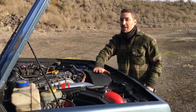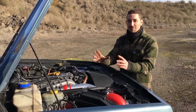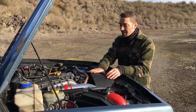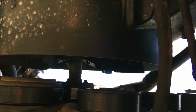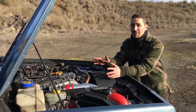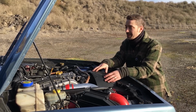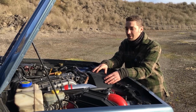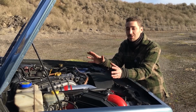It meant I had to put a new cowl on because the original cowl has a lump at the bottom for that intercooler, as I mentioned before. So I got the cowl off the petrol Cherokee and put it on here. It took some jigging around, but it's on there now, and all in all this vehicle runs very, very cool. About 85 degrees, and at full load just below 90, so I've never had any overheating issues since I rebuilt the engine.